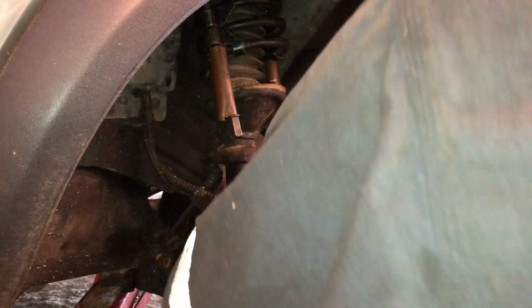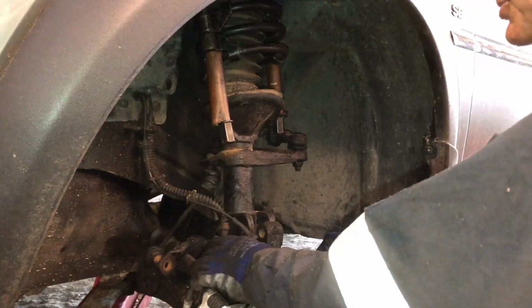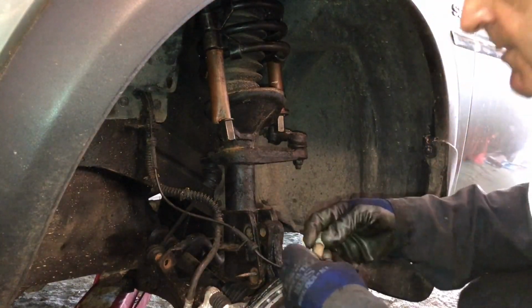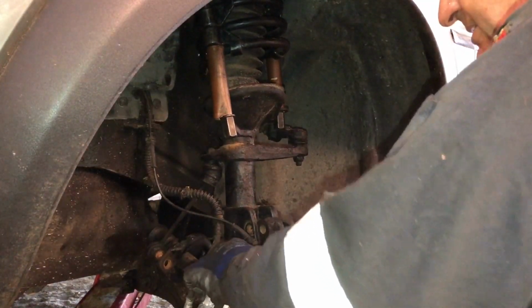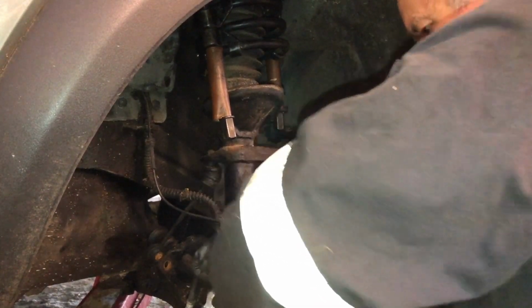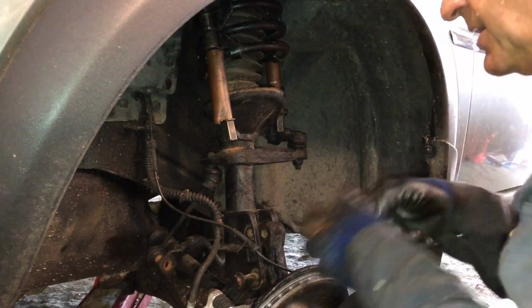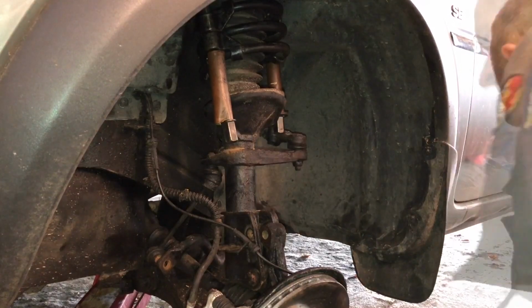What we need to do now is get the strut lined up with the holes. You'll have a little screwdriver so that when you can see a little bit of hole alignment, you can pull it into place. There we go, let's get the screwdriver through. It gives you a bit of leverage. You get one of the bottom bolts, and then with a bit of manipulating with the screwdriver, looking at how the hole aligns, get it to the right position. There we go. For that bolt, just tap all the way through, and that's fairly secure.